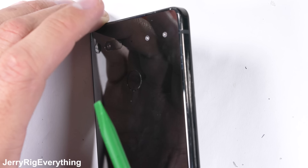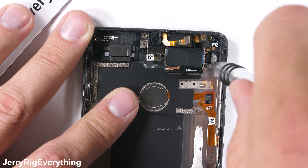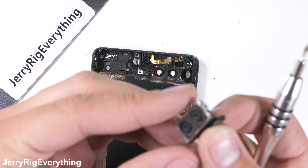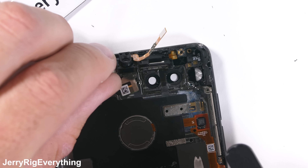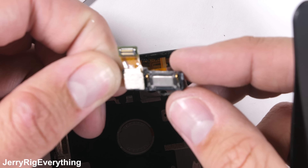The fingerprint scanner is replaceable, but there's no wireless charging anywhere to be found. The dual rear-facing cameras have two screws holding them in place. Removing those gives us a close-up look at the 13-megapixel lenses — no wide or telephoto, and no optical image stabilization on this phone. The 8-megapixel front-facing camera popped out with the earpiece — kind of an interesting looking contraption.